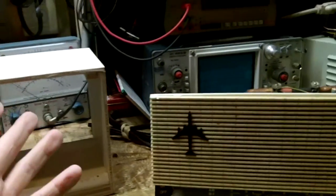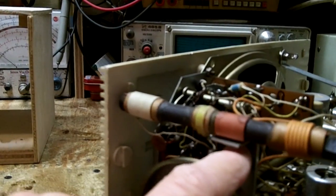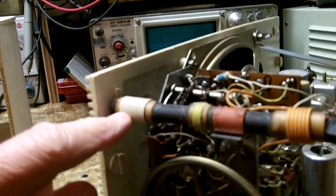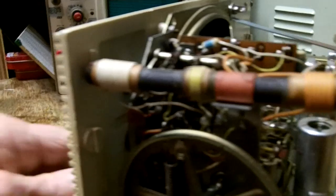The only other thing you can do is cut a little notch here and a little notch there and slide the radio out. I got to get my magnifying glass — I think this loop stick is held in, there might be a nut underneath. If there's no nut I can take that off, but I don't want to break any wires because they break off inside here. I can't get my saw in there without hitting this, so I've got to get the loop stick out of the way somehow and just hope I don't break anything — especially the dial cord.